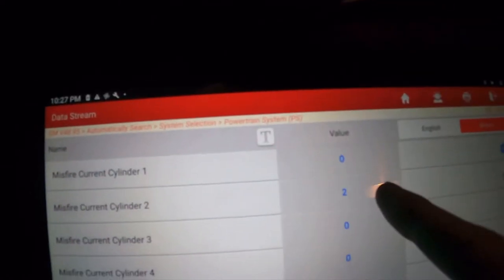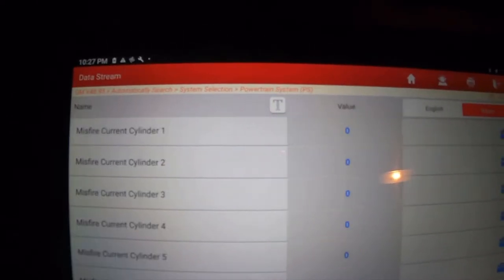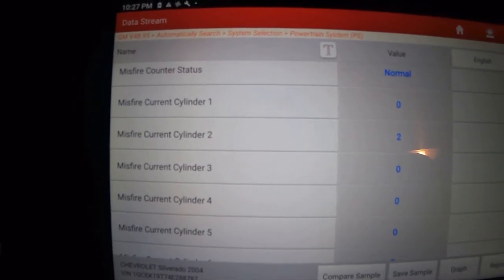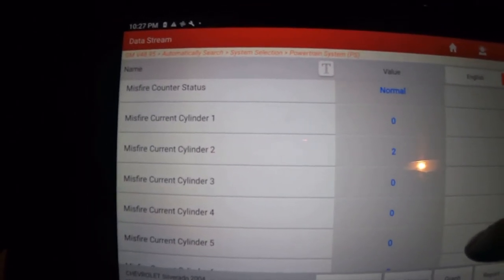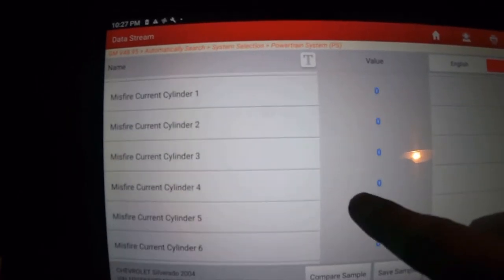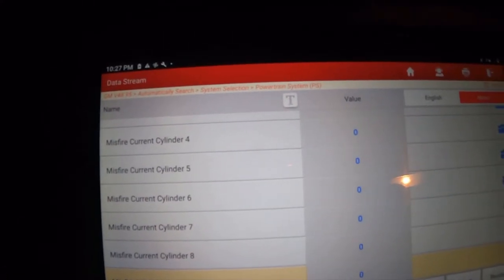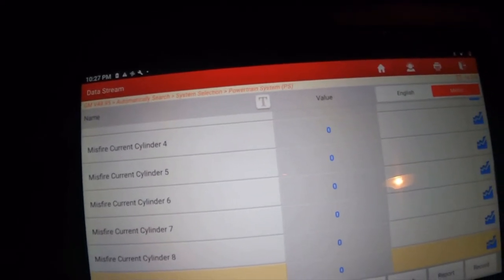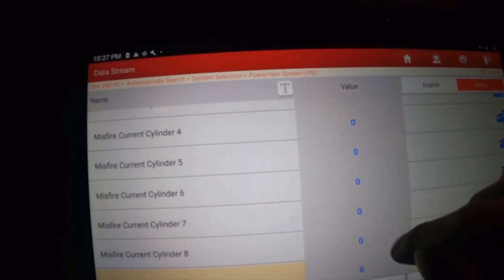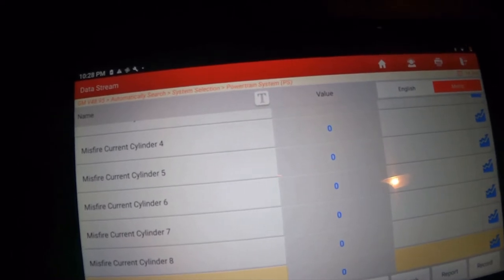using this scan tool. Oh, look, a little bit of misfire. Using the scan tool, I was able to figure that out and isolate the two most problem injectors. I mean, there's still a couple that misfire every now and then. That's kind of, I'm gonna say, a needs-to-be-run situation. Anyways, we figured those two out, went ahead and acquired the parts. We just got done with that. Now I'm just letting it run. Wrapping this video up.